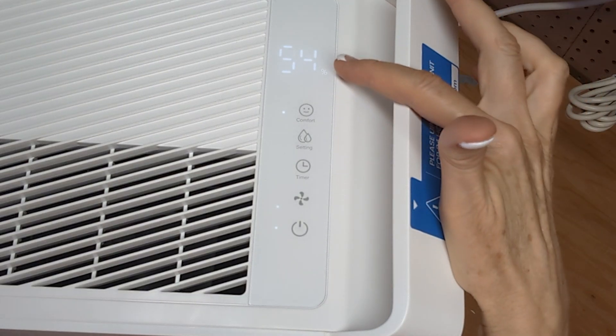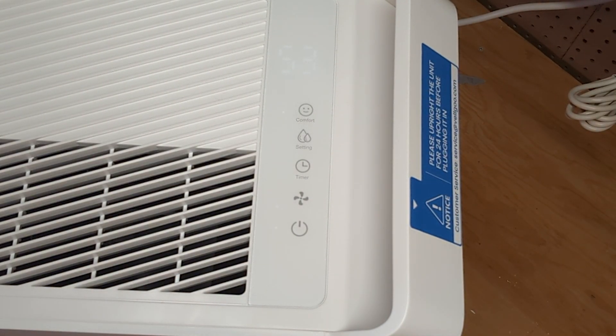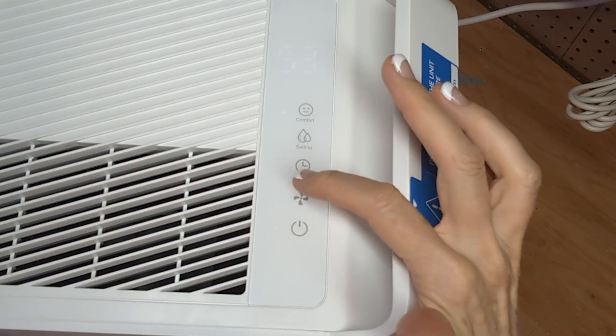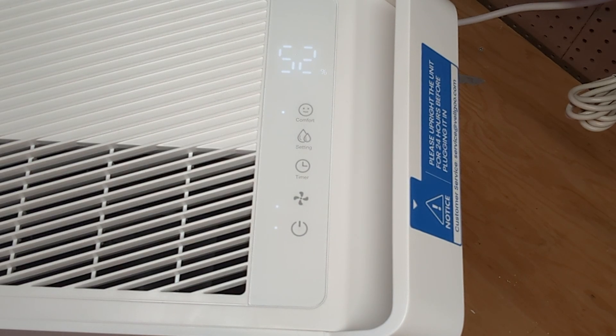Let's turn this on. 54% is what it's set to, and it's actually at — it looks like it says 53, so it's going to change on its own. I need to set it again. I set this to comfort mode. When you set it to comfort mode, it will automatically, intelligently determine, based on your ambient temperature in the room, what relative humidity it should get to. So if it's less than 65 degrees, it's going to get to around 55% relative humidity; if it's over 77, it's going to try to get it to 45% humidity, and so on — that's all in this booklet. Continuous mode is the mode it's on by default. You can also set it to manual mode so that you can have a targeted humidity range if you want something different than the comfort mode.